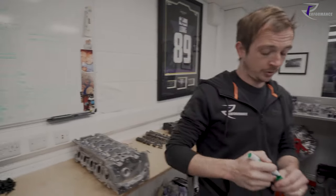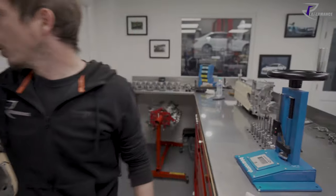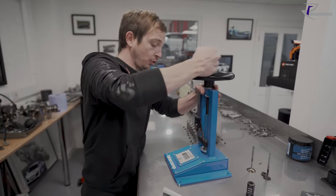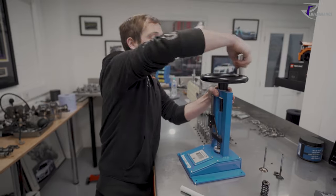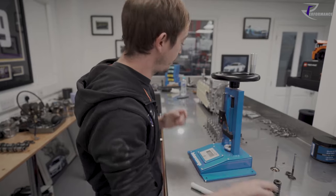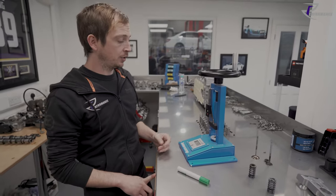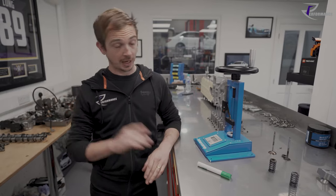So we've got more pressure on the seat, we've got more pressure in the spring, but we've got a mil less of spring clearance. So we run into coil bind a mil sooner, or 1.1 mil sooner. So what that means is now we would assemble a valve train, we would put soft springs in place of these, we'd build up the time and assembly, we'd rotate the engine, and we would figure out how much lift we actually have.